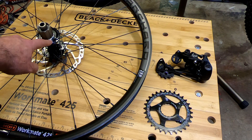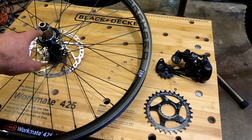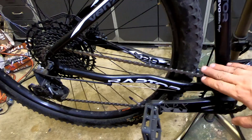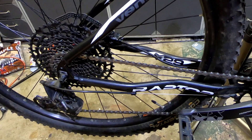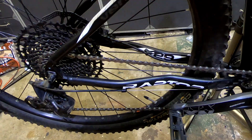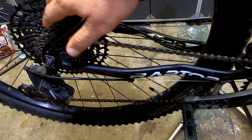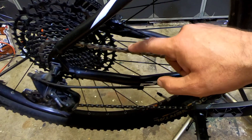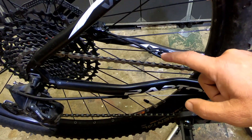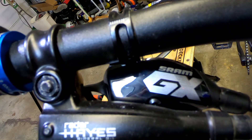Note that you cannot go from a 7-speed rear system because the 7-speed hub is different — 8, 9, 10, and 11-speed are the same hub. Here I have my 12-speed system on my Venso. This wheel — a WTB STi 25 Shimano HG wheel set that I bought — initially had an 11-speed cassette on it. I went and got the NX cassette, 11 to 50, along with a SRAM NX 12-speed chain.